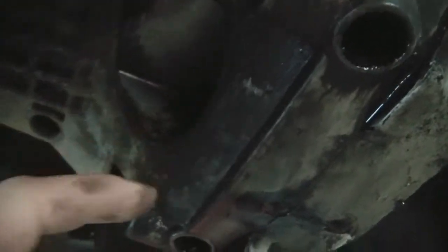I should also mention there is a little oval port here at the back of the block, and there's a plastic cover that goes in there, and that gives you access to the bolts that hold the torque converter onto the flex plate. I was able to take a screwdriver and spin the engine over with the little nubs on the torque converter.